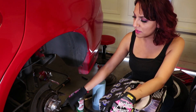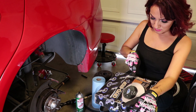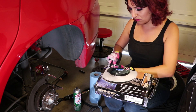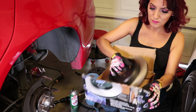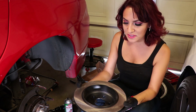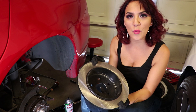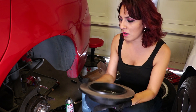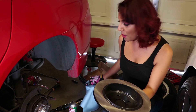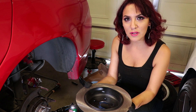The hub is fully clean and ready for the new rotor. So now we're going to unbox it. This is the new rotor — very clean, very nice. One thing to notice is that when you get your new rotor, it's covered in oil. The reason is it's iron, so when they ship it to you it could rust, so they cover it in oil. Before I put in my new rotor I always clean it with brake cleaner and some paper towels, but never by my car because I don't want the brake cleaner to eat away my paint.